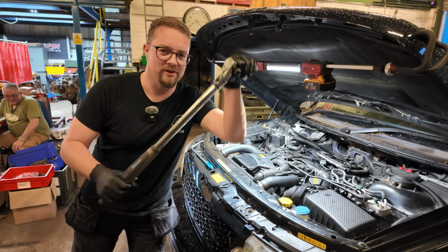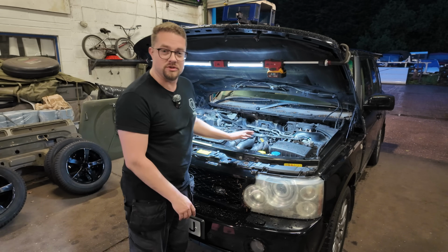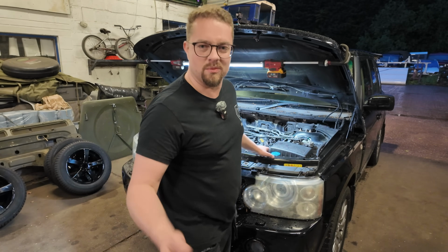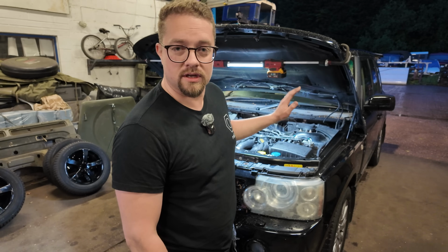Use a torque wrench. Right, so filter is in. It's tightened up to 35 Newton meters this time, not Dave tight, and all seems good. So we're just letting it heat up just for a double check. Get underneath in a minute and check it out, because where we did have it, some oil had washed off from the water coming through, so we're just making doubly sure. But this video, I think, is pretty much done. So the car is serviced.